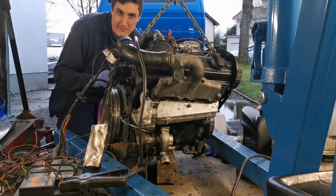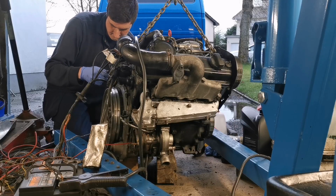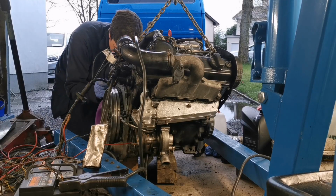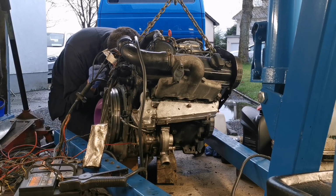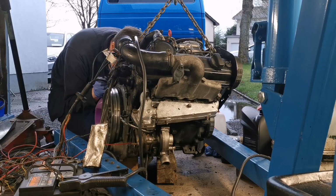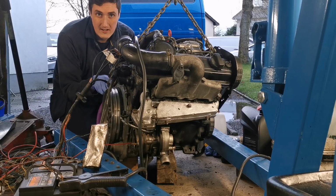Right. I'm going to pressurise my fuel tank again. I'm going to crack the injectors open because I think this was running on the easy start, but it's going to start. Okay, so I can hear air coming in through the fuel return line now. You see a few drips coming through here now. Okay, so now we're getting drips through the fuel return line.